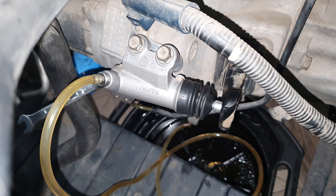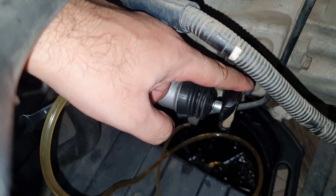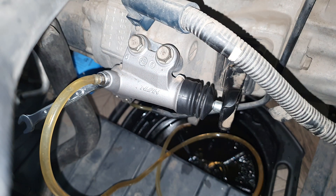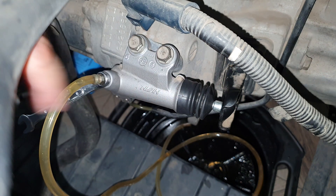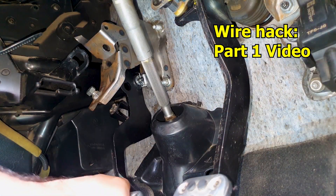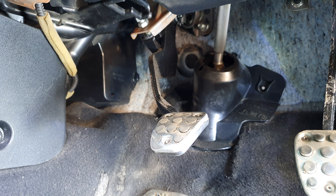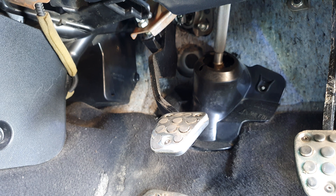As you heard, the squeak is still there — and I figured it out. It's coming from inside here. There is a clip or spring or something that allows this to move back and forth; I need to put grease in there, but to get grease in there I need to open this boot, and it kind of ripped when I tried earlier, so I'm going to order the part first. After opening the clutch master cylinder and finding it was in superb shape, I wasn't expecting the creak to go away, but the intensity has further reduced — still making progress. The clutch pedal is now buttery smooth minus the creak. I'll fix the squeak once I get the part. The creak I still have to figure out — it is that middle bushing I identified in the first video. As always, thanks for watching.